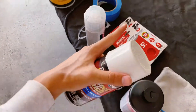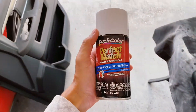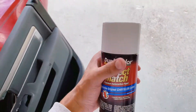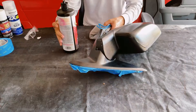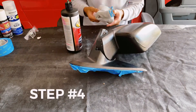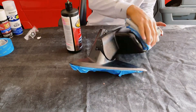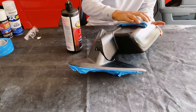After you've got it prepped, sanded, and primed, you're ready for paint. We're hitting it with this Perfect Match bright white — it's going to look real nice. So we've run through all our steps and got all our products. Now we're going to start the work. Grab your wax and tar remover, pour it on your cloth — it does come out a little watery so be careful not to pour too much — and just wipe it all over until you get a whole coverage.